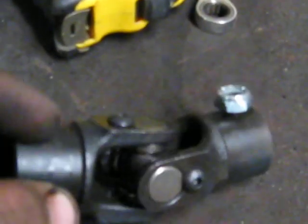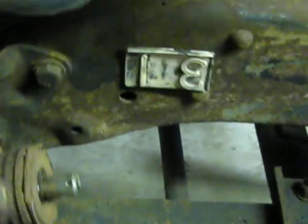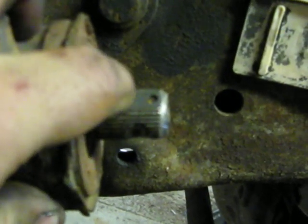So after we fixed my dad's with the U-joint, which we have another one for this project right there. Okay, I'll be ready. There it is. Now I showed before, we'll smooth one end, 36 splines on the other. The Dodge steering box has a keyway right there. That's for your roll pin, for the stock connection on a Dodge. And then there's an actual flat on it.